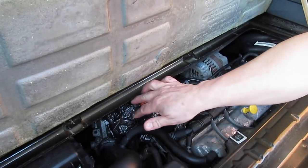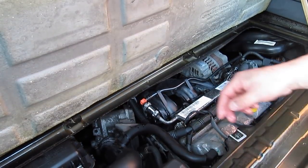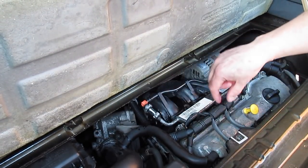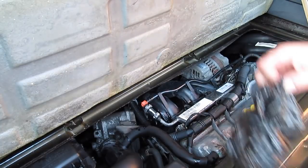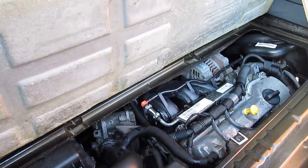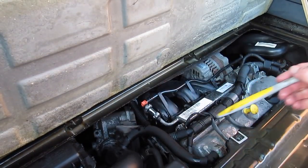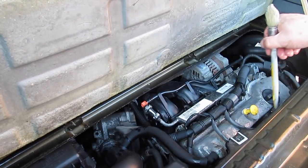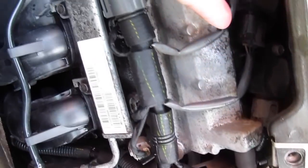So what we're going to do now, carefully, is take off the bags that covered the electrical components. As you can see, they're still there. I'm using hair bobbles just to keep them in place and wrapped around, not so much the coil packs which sit on top of the spark plugs, down at the right of the back of the engine nearest to the rear of the car. Because obviously they didn't get any gunk on them and they didn't get any water in them. Here are the areas we're going to pay attention to — all along here, the coil packs and those areas we had the bags over. Here's a better look at a coil pack — you can see there's still dirt and grime on these electrical connectors and in these coil packs.